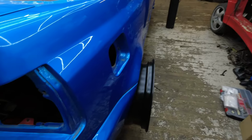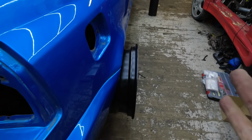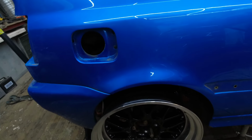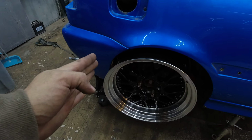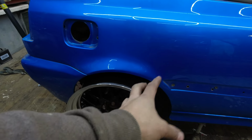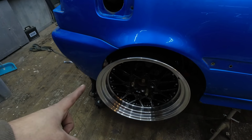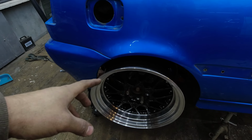So we began tracing in the back wheels, and that took like 3 hours, because if you do it wrongly now, everything's gonna be off. So we had to adjust the camber, we had to adjust the toe. So now especially the height, and as you can see here, the wheel is very far in behind, but that's because of the new Dodge chassis that we have put on. We did it this way because I wanted much more space when we feather in and feather out.